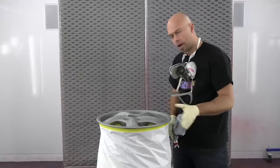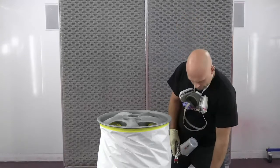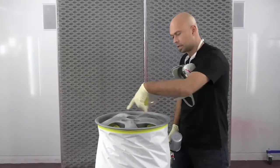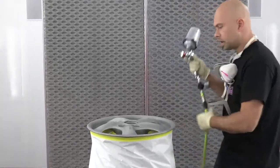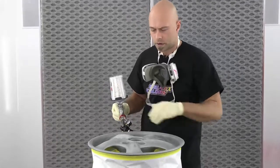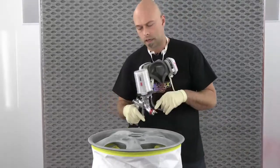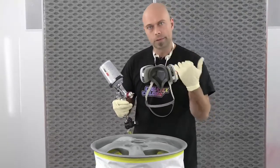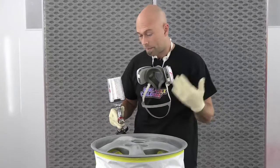Hey guys we are back. I got my wheel all wiped down — wiped it down one more time with the SX394 and a little tack rag. It's ready to spray and I also have my little center cap to match at the same time. I'm spraying it off the wheel just so I can get the edge and the inside lip of the wheel as well. I'm going to apply our silver sealer — probably two coats. I'm using my Iwata W400 WLBX at 18 PSI, a little bit lower than the recommended max of 20, because there are all kinds of little valleys in here and I want to make sure I don't have too much air pressure blowing things around.